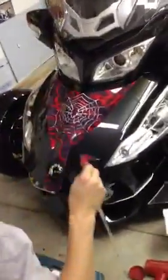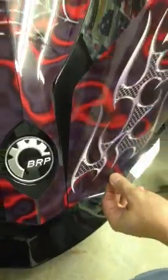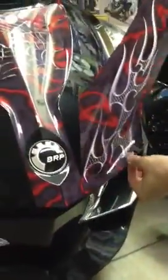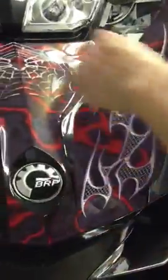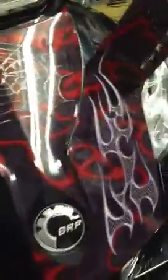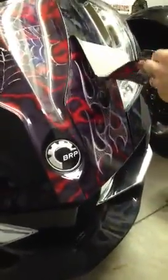For the outside trunk pieces, we start in the bottom corner below the emblem. You're going to line up the straight edge right off the bottom edge of the lip of the trunk. It may take a number of tries in positioning to get it where you want it to start, because you want to do it as smooth as possible. You can kind of lay it up and see where it's going to go if it stays within. Your edging is going to vary between the two pieces depending on how much stretch.